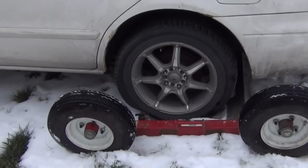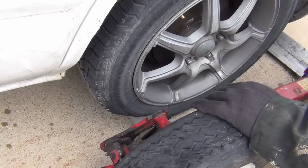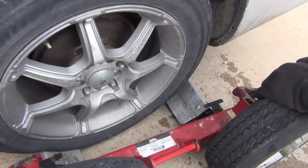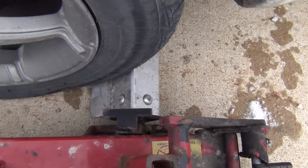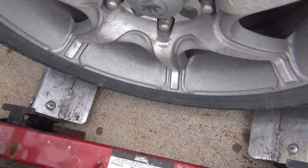Pull the car forward with the stinger so that the flat tire rests or balances entirely on that dolly bar. Then place the rear dolly bar in the corresponding slot on the dolly. Adjust the dolly bar on the other side to match the first side in the rear. Push the car back with the stinger and allow the flat to rest on the rear dolly bar this time, and place the front dolly bar on the non-flat side into the correct dolly slot. Test it. Raise both dollies and check for clearance.